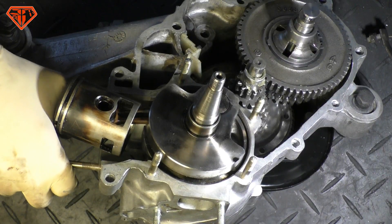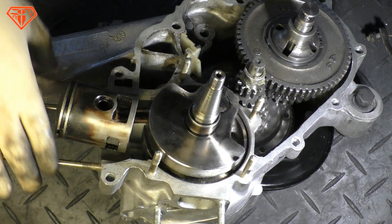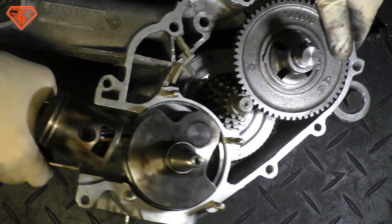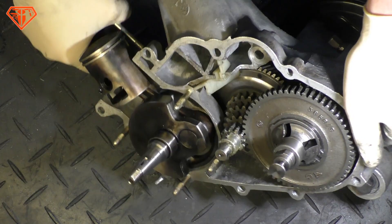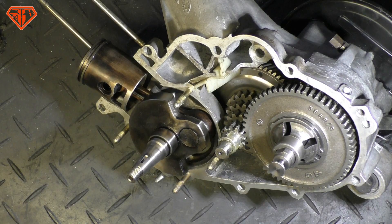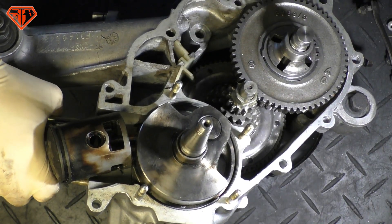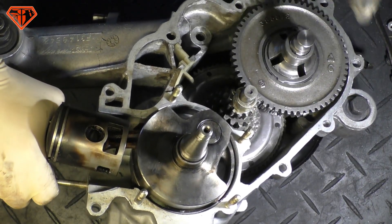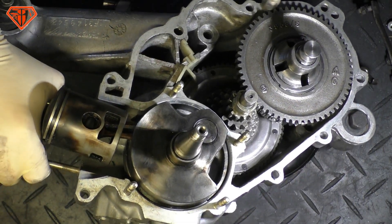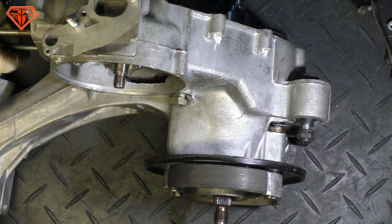The next thing to be checked - I don't have the tools to measure the bearing seats, so I just put the bearings in, and yes they are fine. There are some cases from a specific brand where bearings get loose, where the seats do not have the right size. Not so with this LML case - it's fine, all bearings go in as we're used to, everything looks fine.